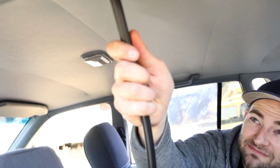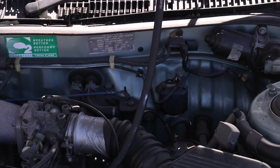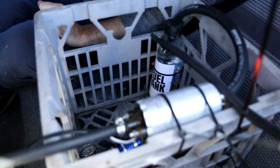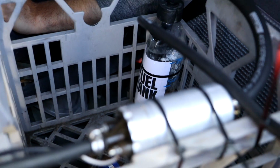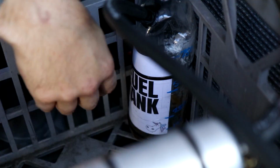Now, we've done this using the external fuel pump off a VL Commodore, which is pretty exciting, and then we've also got the fuel line running from the pump out the roof of the car for why I don't really know, but it looks cool, and it goes all the way out the front back into the fuel rail at the front of the car, and we're also picking up the return fuel. So we're measuring, we've got a set amount of fuel, it's using some of it and it's putting the rest back in here, and after we've done some of the tests we will see a difference on here, and that'll tell us exactly how much fuel we're using.